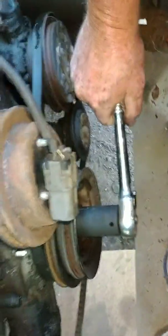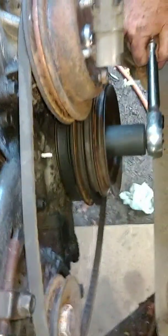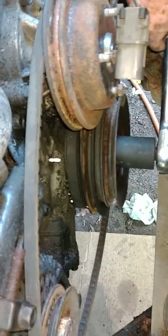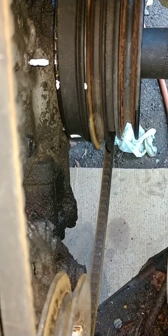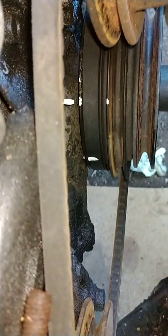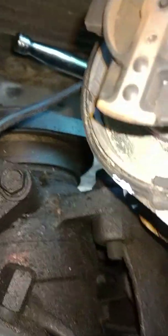She's still got some compression in there. We should be coming around here pretty soon. Here she comes. When this thing is running, you'll put a timing light there and that should be aligned 10 degrees before top dead center. We want to go 5 there, and this is my zero mark right there. I'm marked up at top dead center. I'm not on my exhaust stroke anymore on my distributor because my rotor button is pointing to my number one plug wire.